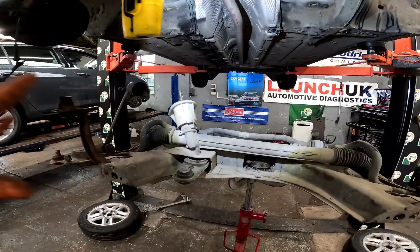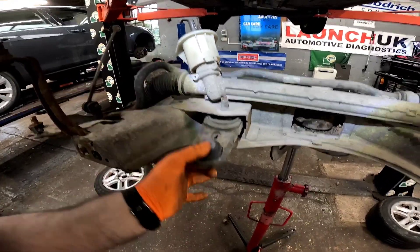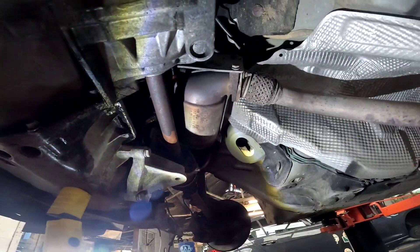Once you've got the vehicle fully raised, this subframe is probably one of the easiest subframes to take off. Four bolts either side and we've got an engine link here, an engine stabiliser link at the back of the engine. Simple to get off. Look how much room we've got up there now to get the turbo off.